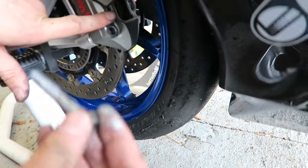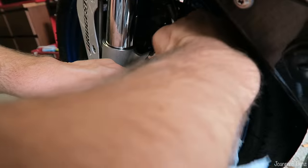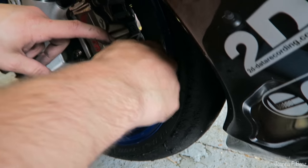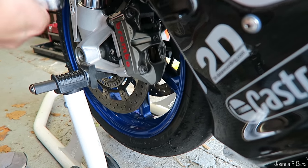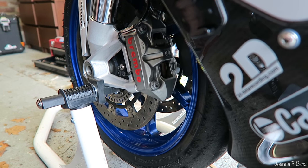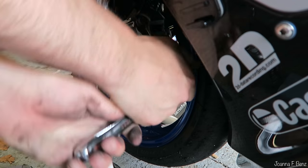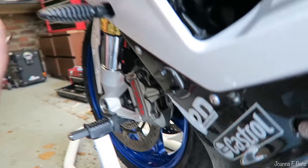You can check, there's some grease on here. Sometimes you can use copper slip or this silver grease. I don't like this silver grease. It keeps coming back from BMW covered in it, it gets on everything and doesn't come out. And you do one side at a time, because if you're pumping the brakes and you've got both calipers off, they're going to close completely and you'll never be able to get them open again. Obviously, you want a fairly hefty torque on this, I don't know the exact setting, but it's basically a pretty hefty pull. And that's it.